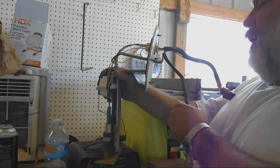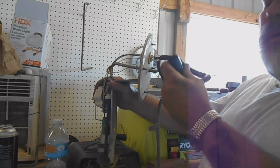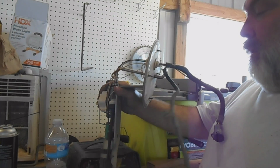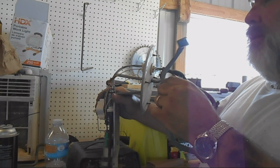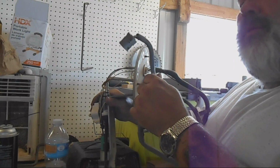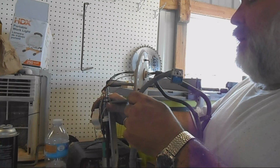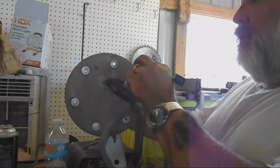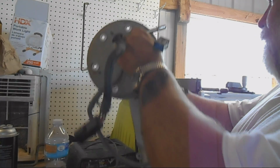There's 2 wires. This pigtail plugs into the car, which was up underneath that frame piece, between the frame and the body. This goes to your pressure sensor for emissions stuff. It goes up on the top. This is the part that would be really hard to remove without removing the tank, because that jams between the body and the tank itself. Then of course this is your actual hose for the fuel out, for your pressure line going to the engine.